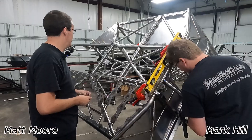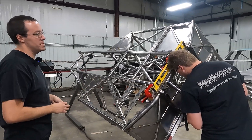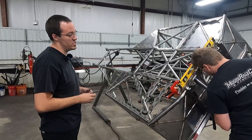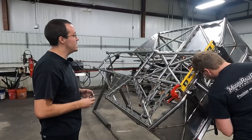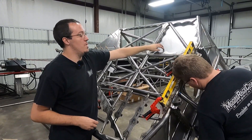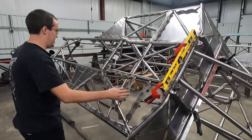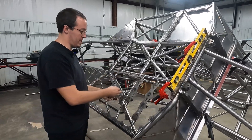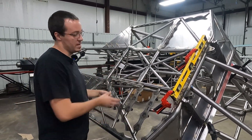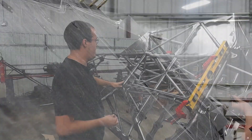I'm working on the center belly pan. I'm setting the Zeus fasteners, and Mark's doing the back scallop strips. All the carbon will be on the underside of the car for airflow and aerodynamics. It's a little confusing because it's upside down, but the driver's over there. It has the .090 plate for the 25-1 spec, titanium under the driver, carbon on the passenger side, and this center section will be carbon but Zeus-fastened — bolted on, or you can do rivets. That way when you pull the driveshaft out to pull the trans or third member, it all comes out easy.